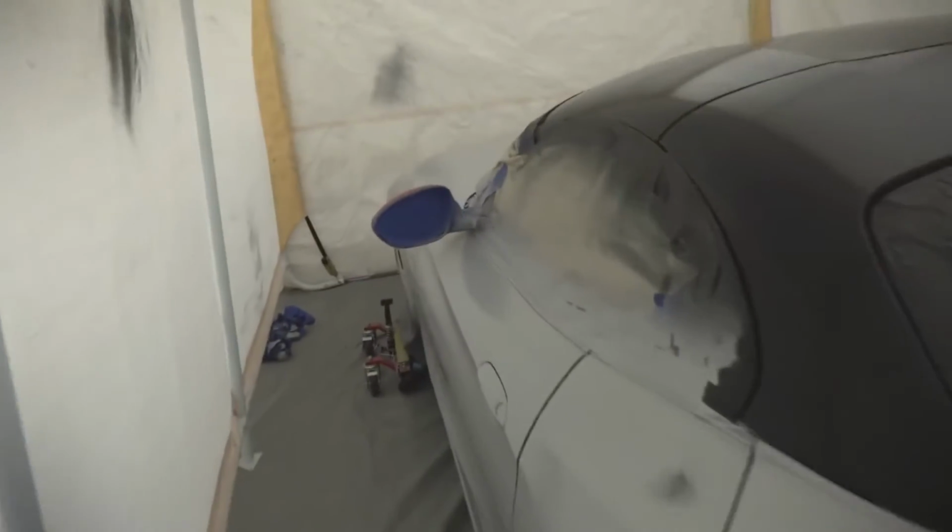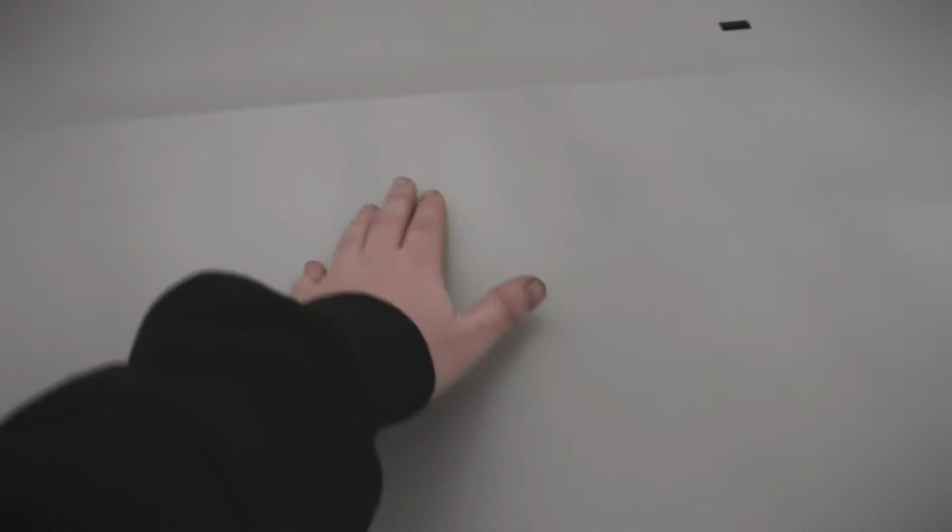Oh, B is for build and B is for busted up paint jobs. So we got a little bit of tiger striping. You can kind of catch it on camera right here, side to side. Last night, these were the parts that were super puddled up and still very wet. Tiger striping comes from a myriad of different reasons, but anyways, the way to go is paint like this and then come back and paint like this, which is what I did, which is why the tiger stripes are going that way. It's super annoying to me though, and it doesn't have to be there.